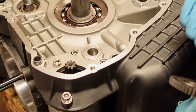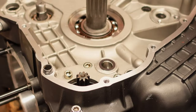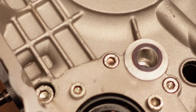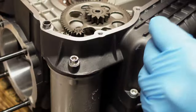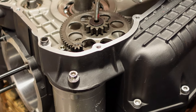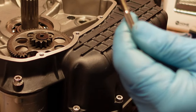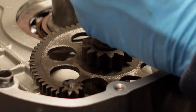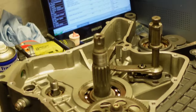First we're going to stick in the starter wheel. There's a little dowel that supports the shaft, and it's a large wheel with a cut-out in the casing you have to line up first. Put the dowel through, then a washer sits on top as a spacer washer. A little bit of Loctite on there - I'll just check it turns through its hole first before applying it. 10 Newton meters and we're done. There's a special tool to set that up.